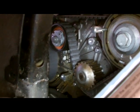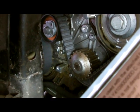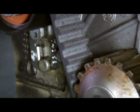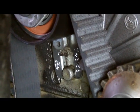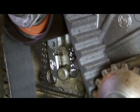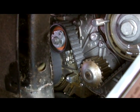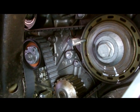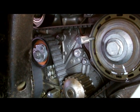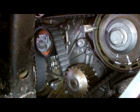Okay, we've got our tension, our belt there now, and you can see a little hole there. It's lined up with the notch there. Just put a bit of paint on that and you'll see it better. So our next step, after we check all the nuts and bolts, we'll remove all the pins again. We'll crank the engine 6 times clockwise, then recheck the tension, recheck the time marks, then we'll put the covers back on. That'll be our next operation.